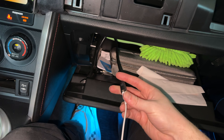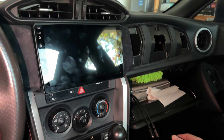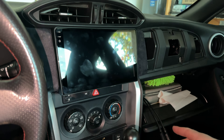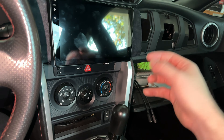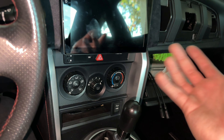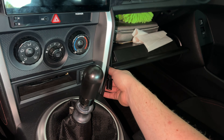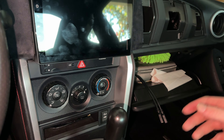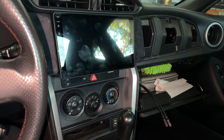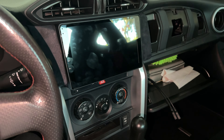I'm pretty sure I just had it plugged into the wrong port. This red one here is for the USBs and there are two same-size entries, so we're going to flip it to the other one and see if that works. Alright guys, we plugged it into that other port, going to turn on the accessory and see if we get power to the USB. I'll have the USB in my phone and — okay, I got it in — and still no power.